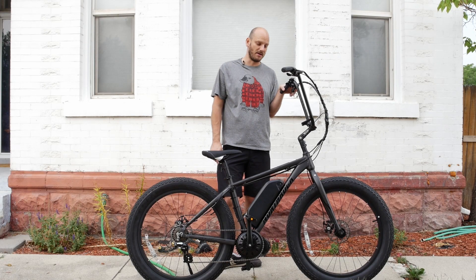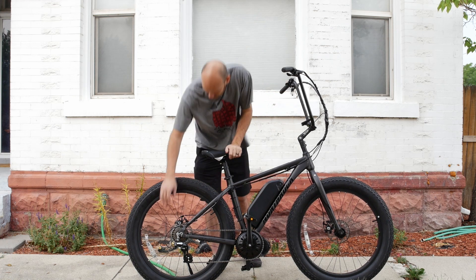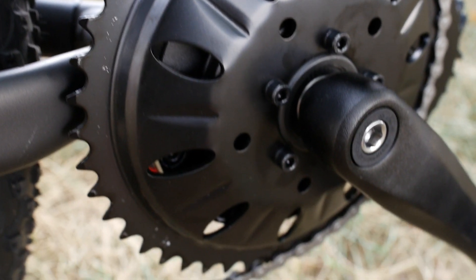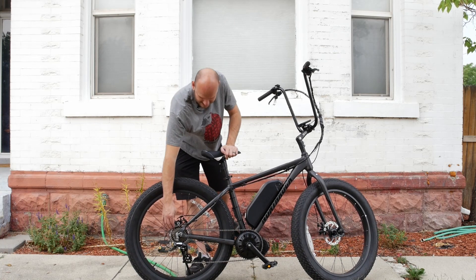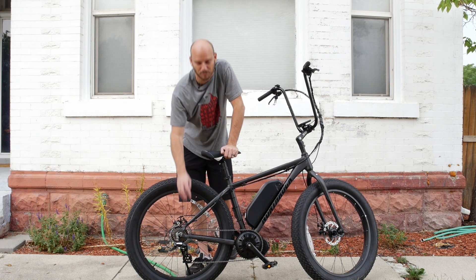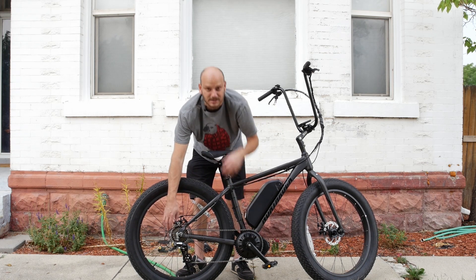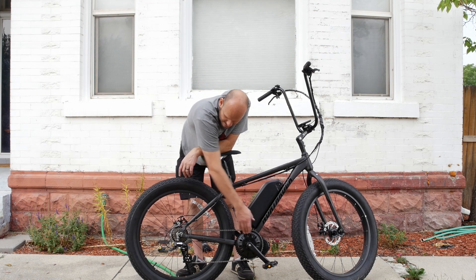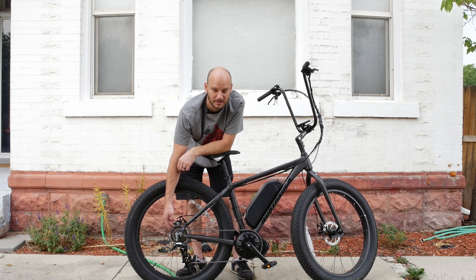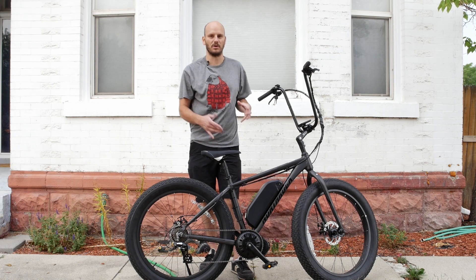Alright, so you can see top speed was 35 miles an hour without pedaling — so this thing boogies pretty good. Hill climbing was good with a running start. From a standstill, this thing failed because the low gear is small — that is not much of a hill climbing gear. We went with the stock chainring, which is 46 tooth up front and I'm going to say about a 28 tooth in the back as the low. That's a pretty big gear ratio — not a very big low gear. Switching that out to a proper low gear would make a huge difference for hill climbing. The closer you get to a one-to-one ratio — if you had 36 tooth up front and 36 in the back — the hill climbing would just be a beast. But at 46 and 28, that's almost a two-to-one ratio, putting a lot of strain on the motor. It's behaving almost like a hub motor. So I would replace that 28 tooth — you'd then have a proper hill climbing off-road machine.